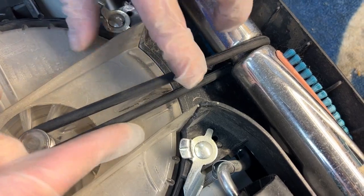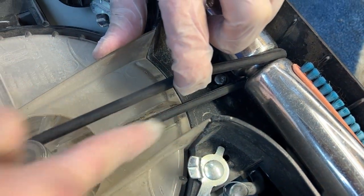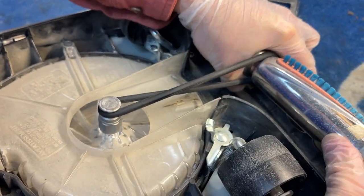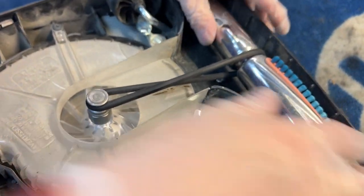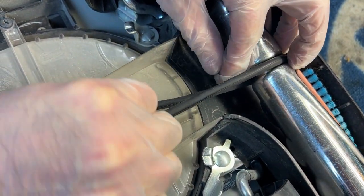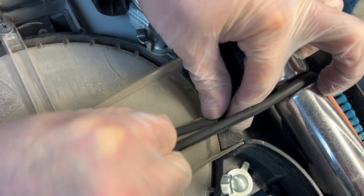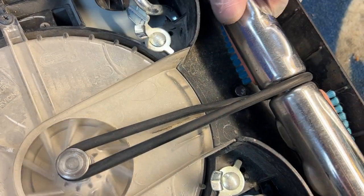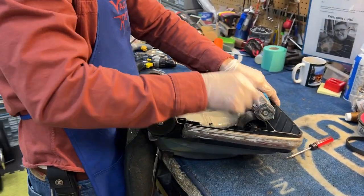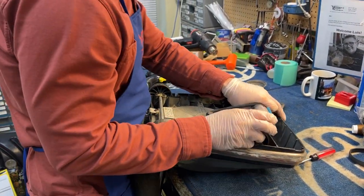You know you've got it on right because it's going over that groove right there. I'm going to put it on wrong real quick and flip it so you can see — here I've got it on wrong, you can see it's not lining up with that groove and in fact the belt is pushing up against this. If you turn the machine on like this it's probably going to break the belt. So watch out and make sure you get your belt lined up with that groove.